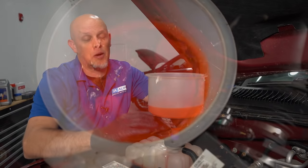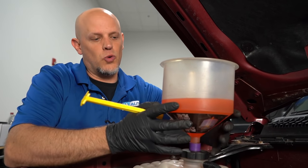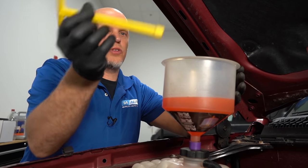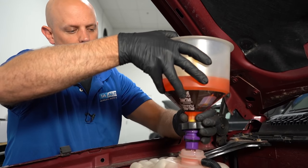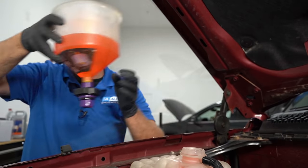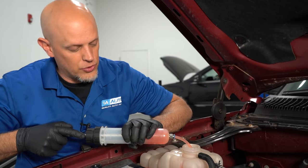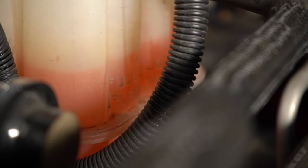As the vehicle's running, you're going to notice bubbles coming out of the coolant, and that's normal — that's the air burping out and allowing more coolant to enter the system. After you've run the vehicle with this funnel on, the engine's hot and everything's burped out. Let this cool down, let all the rest of the coolant go into the reservoir. Once it's cool, you can take this little piece right here, put it in the funnel, and then remove the funnel with the rest of the coolant. If you have too much coolant in there, you can use an extractor or a fluid transfer pump to extract it so the coolant level is where it's supposed to be.